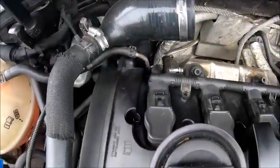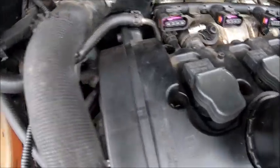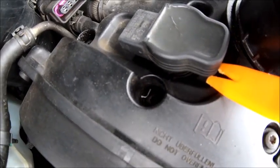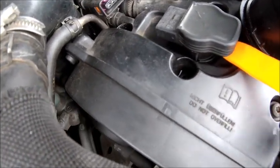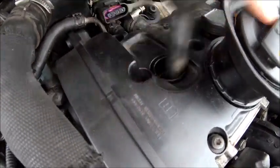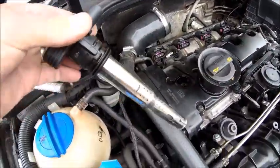So basically all I'm going to do now is take the rail off to the coil packs, take all the coil packs out, and then get the spark plugs out. The connection rail's off. Now a quick top tip: the coil packs can be quite stuck in there. What I tend to do without damaging them is get your pry bars underneath there and give them a little wiggle — and they pop straight up. Easy as that, without damaging the plastic or messing around.